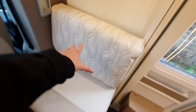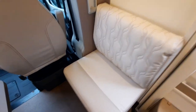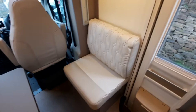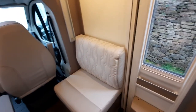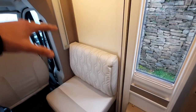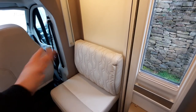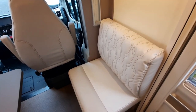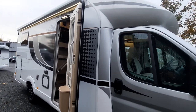Finally, underneath this seat you've got a solar panel regulator and your leisure battery, accessible just underneath there. You don't need to do anything with that — your leisure battery will simply be topped up by the solar panel, and the solar panel regulator in there will regulate the charge constantly fed to the leisure battery. That concludes your handover video on the Lizeo 728 — I hope you enjoyed it.